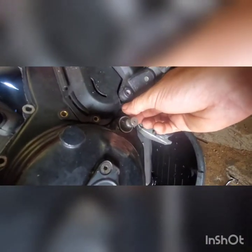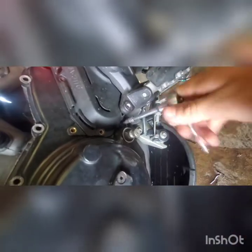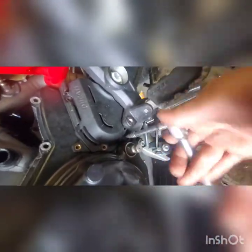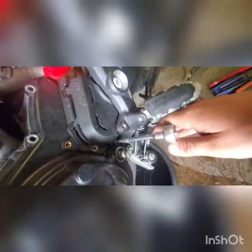That gives you access to the bottom bolt to get your sprocket cover off. Those are four millimeter Allens. There are four of them total — I've already got three removed. Take your tool of choice, use a quarter inch bit on a ratchet to make life easier. Break it loose. The majority of these bolts have loctite on them so they come out hard pretty much all the way until the loctite comes off. I don't like using electric tools on small bolts like this. Your cover should come right off once you get the last bolt off.